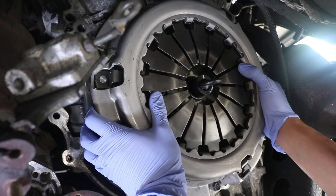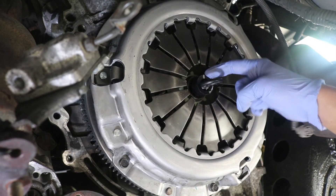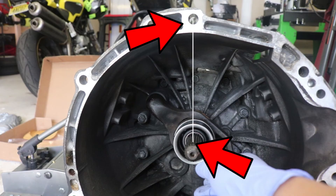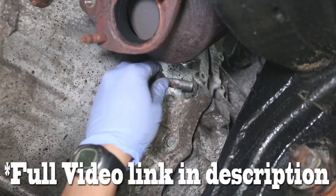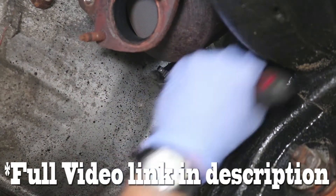But before we reinstall the transmission, there are a few steps you can do to make the reassembly of the transmission against the motor easier. We have to make sure that the spline on the input shaft lines up with the spline on the clutch. Going back to the clutch assembly, we orient the flywheel so that the tooth mark that we made on the alignment tool is lined up with the top left threaded hole. We can orient a tooth on the transmission so it's lined up with the same mounting hole. Now we can finally reinstall the transmission — the fine details on that work will be in another video linked in the description below.